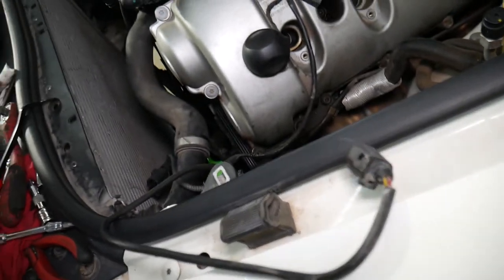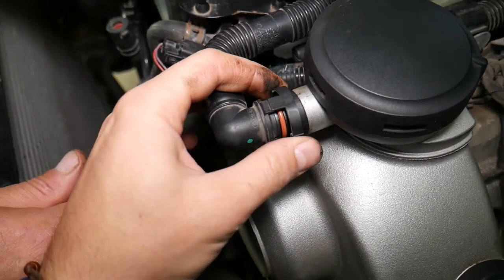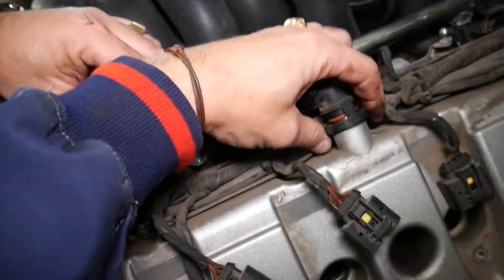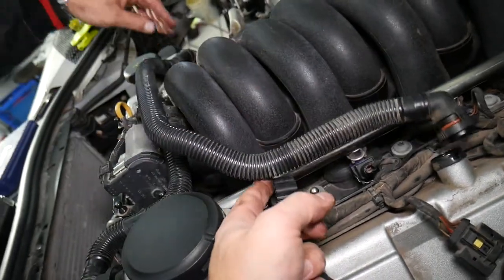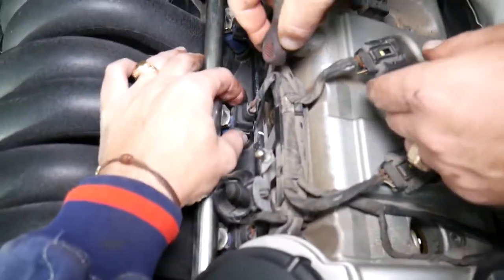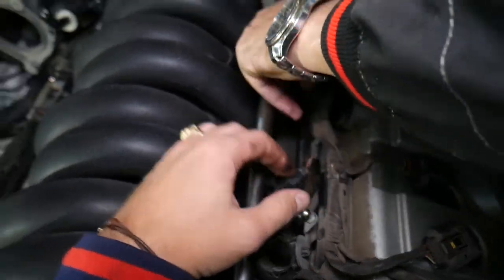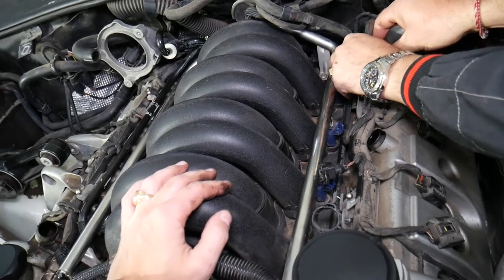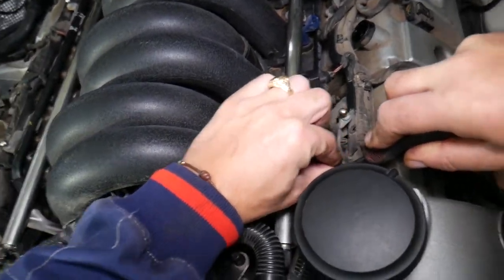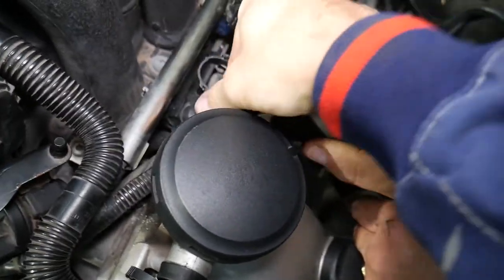Always work with gloves — there's quite a bit of engine oil. For the hoses, you squish on both sides to push in and release the teeth, then pull it out. Same thing applies to the other one — get it out of the bracket with a screwdriver. For the fuel injectors, press the metal clip in and pull it out. You press it in, pull the injector wiring harness out. It's quite a bit of work — that's why valve cover replacement is expensive.